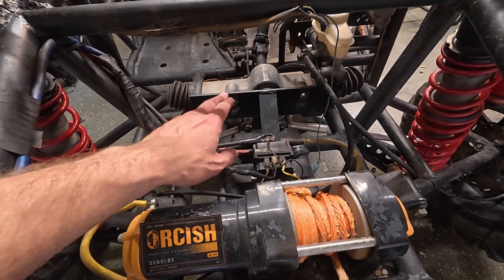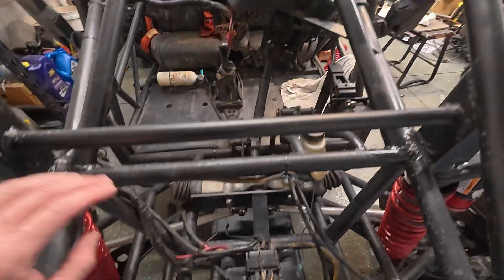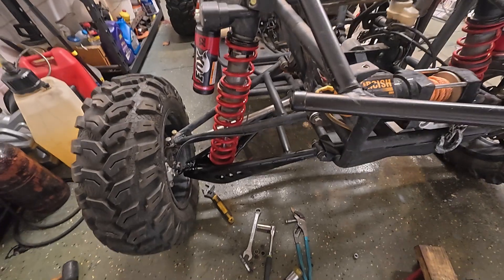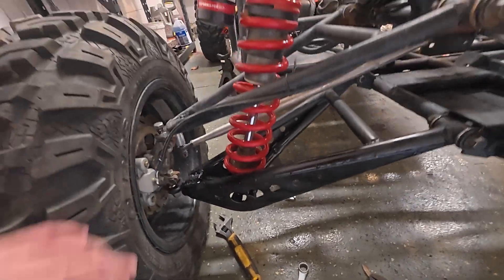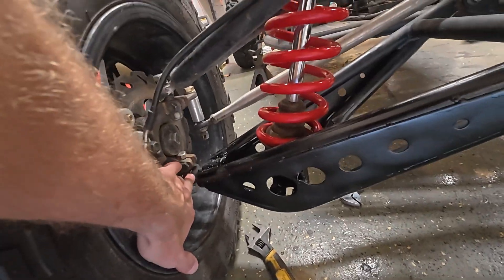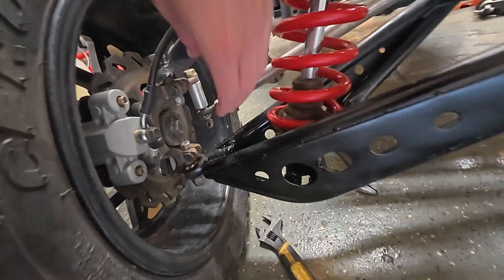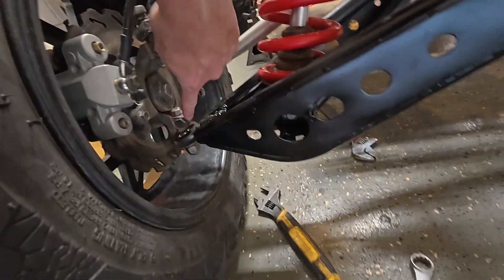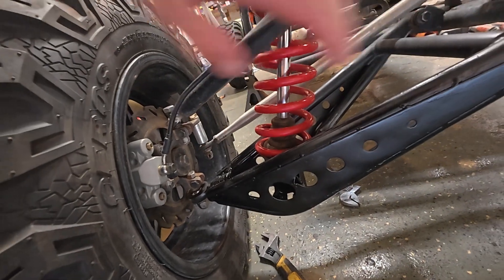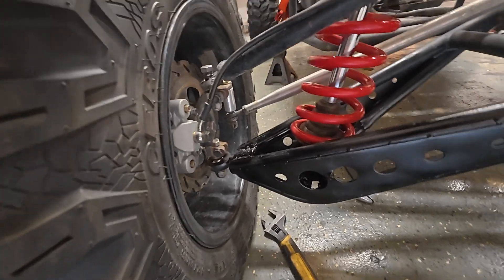On this project I do have power steering. This is my steering rack here and you can see the power steering unit hooked up underneath there. The main reason why bump steer happens is because we have differences with mounting locations between the upper A-arm, the lower A-arm, and also where our tie rods come into the steering system. These three ball joints here and on the inboard side are all going to play a key role in the way that bump steer works.